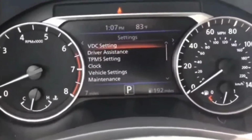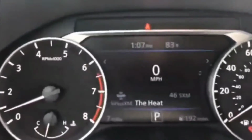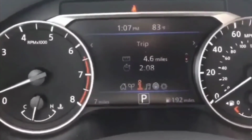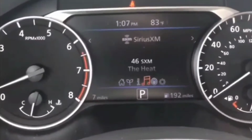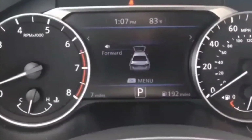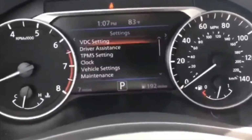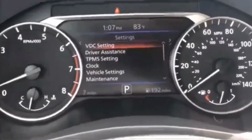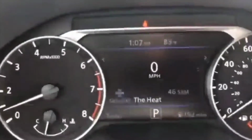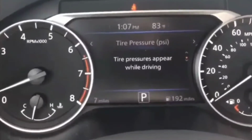And I had an OBD2 scanner, and I knew that it was probably nothing to do with the check engine light or codes or anything, because I didn't have any check engine lights or codes. So what I did was I took the scanner, plugged it in, and just ran it to see if anything came up, or whether the ECM had any kind of issues, because there's been cases where if there's no communication with the ECM, the code reader wouldn't scan all the way through. But it scanned all the way through, and everything read okay.